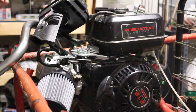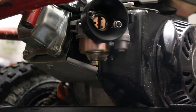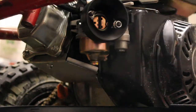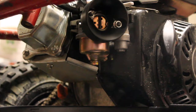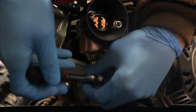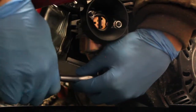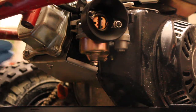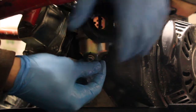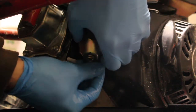The last step we have is the main jet and the carburetor. We're going to be taking off the bottom of the carburetor, again using that 10 millimeter socket. I would highly suggest that before you do anything fuel-related you wear a pair of gloves and safety glasses, because I have taken old nasty fuel to the face and it did not feel good. I'm just going to crack it loose until I can undo it by finger so I don't get too much fuel on my tools. Make sure you've got a pan that you can drop the fuel that's going to come out into, and make sure your fuel flow is off — otherwise it's just going to keep on draining.